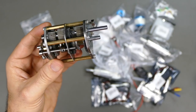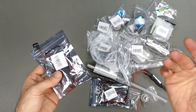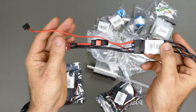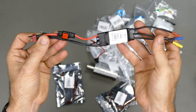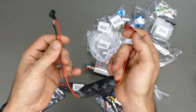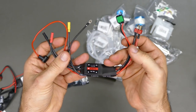I'll try to make that brake work; if not, I'll use a Revo 3.3 two-speed forward and reverse transmission because it also has a brake. Because the engine has a brushless starter motor, you need an ESC to start it. There are different options — a basic 30 to 40 amp ESC with a push button to start it. It connects to your glow plug, you've got a ground going to the side of the motor, and you use a LiPo battery to start it. This is a glow igniter — it's pretty big, and I hope they make them smaller in the future. With two cylinders you need two of these, whereas a single cylinder just needs one.